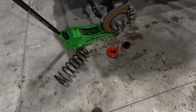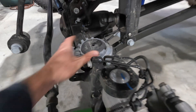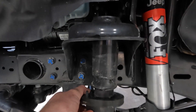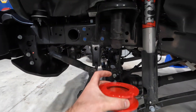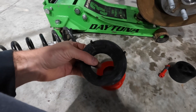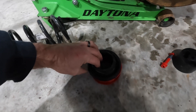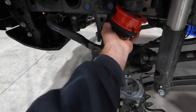The coil spring's out on the floor. You're going to reuse the bottom support - leave that in there. Once you take the coil out you have this rubber isolator up on the top - that comes off and you're going to reuse that. Now the spacer goes up in there. There are two little tabs on it, and you reuse this isolator - see the little protrusions sticking out - they fit right in. So the assembly goes up into the coil perch.